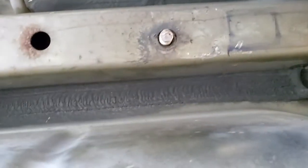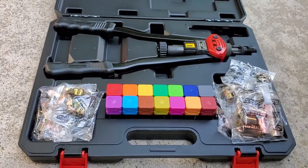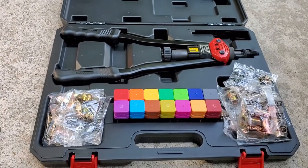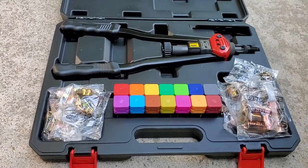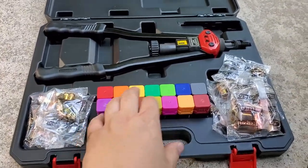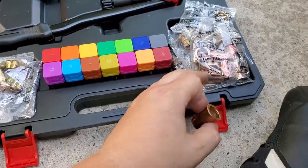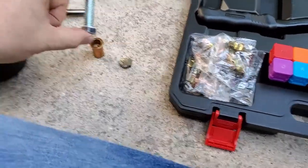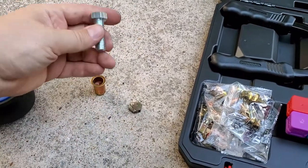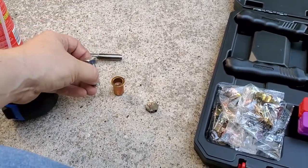There is another way to do this. You need to get a rivet nut tool — there's no other proper and safe way to install a bolt in your frame. There are a bunch on Amazon, and Harbor Freight sells them for $50. This particular one ran me $65 on Amazon because it's a bigger one with a 14-inch handle and more dies and rivet sizes. I picked the biggest rivet in the kit, which is 1.5 size. Make sure you get bolts that are zinc-coated or stainless steel — zinc-coated is a little cheaper but will do the job just fine.